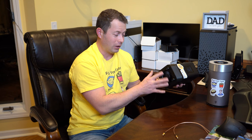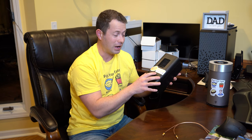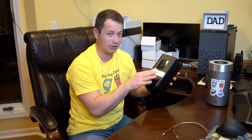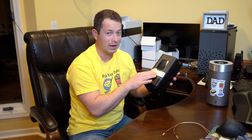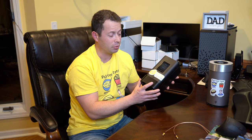I think this is going to be a great thing. If you put this unit anywhere where it gets hot — with it being black, if you put it in a window where it gets a lot of sunlight, because that's where you get the best signal — you might have overheating issues. Or if you put it in an attic or a garage space, that's another thing where you really should think about adding a cooling fan to help your performance.